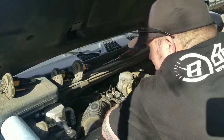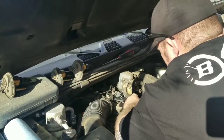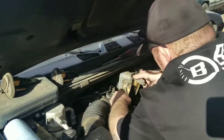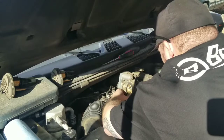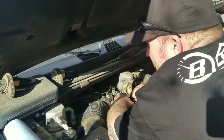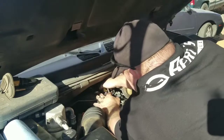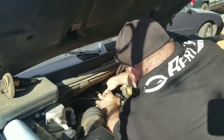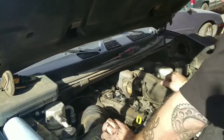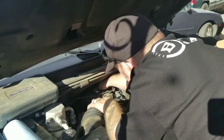We'll put the rest back where they came from — put two back in its original slot. It doesn't really matter which one you put it back into. I could have put it in two or in one. Realistically, I probably could have put it as far back as possible — then if another coil pack goes bad, they'd be farther forward and easier to access. But it doesn't really matter. Number one has a wire loom above it you've got to move before you get to the retaining bolt, but that's not really a big deal.